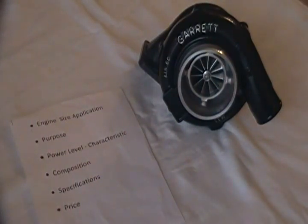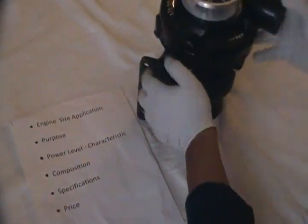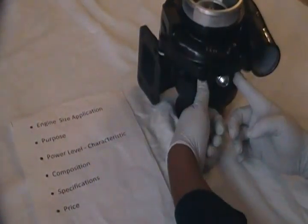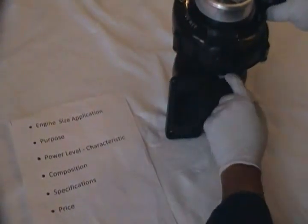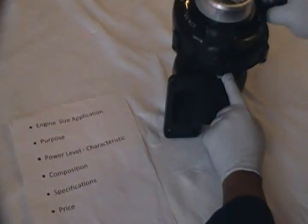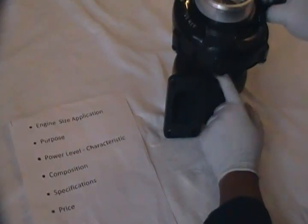Looking at the composition — this has been fully designed, assembled and built by Garrett in Japan. We didn't do any aftermarket adjustments other than the coating for this particular unit. It uses the same restrictors, lines and fitting cartridges as the GT3076R. In other words, this really uses the same flanging system. I have one already fitted here with the allen bolts already set and the same 14mm water fittings that are a requirement in order to run this turbocharger — not an option.